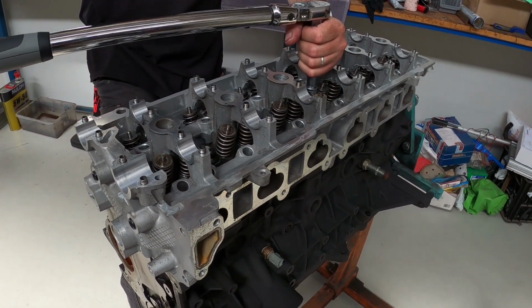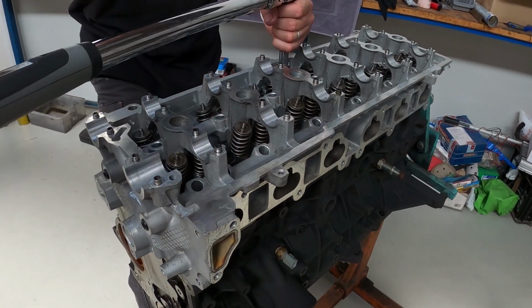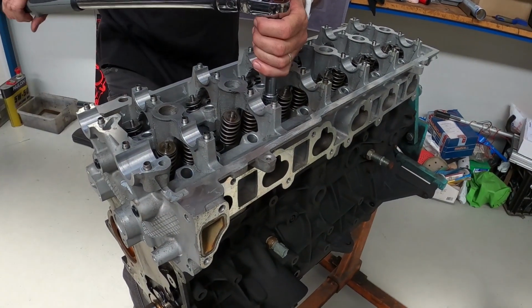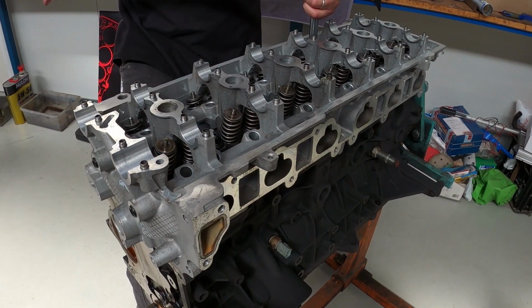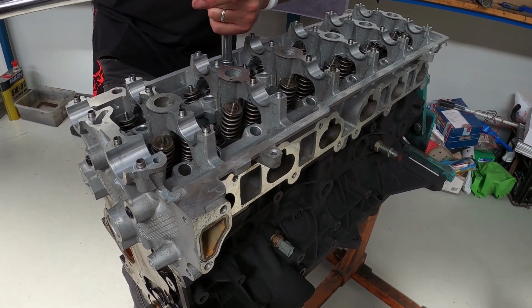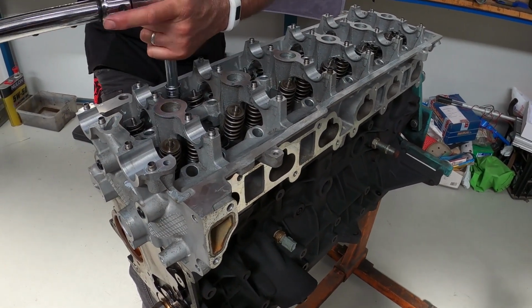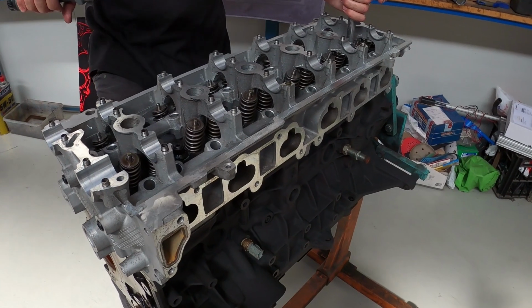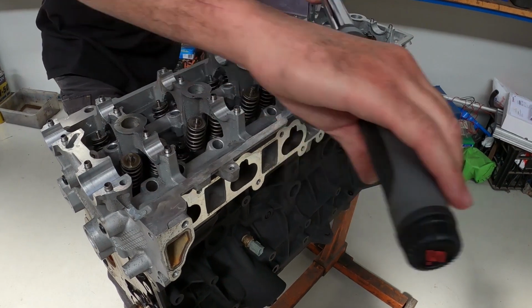You've got to make sure you do these things up correctly in the correct sequence. I think there's 3 stages of torque settings. Yep. I think we finish at 110 foot-pounds. Yep. Which is important. Must do it, or it'll just be pushing the head gasket, pushing coolant straight out the side under a little bit of boost. You don't want that. With the Dominator Motorsports Australia kits, they actually give you the correct torque sequence and settings. Follow the instructions and you can't go wrong.